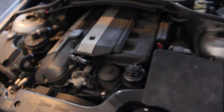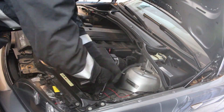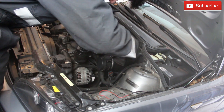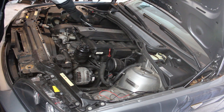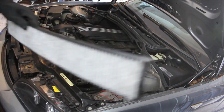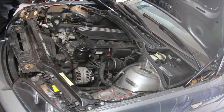This one hose goes down under the intake manifold and the CCV is right in there. It looks like we are going to have to take out the cabin air filter because I'm going to have to take off this engine cover since there's a CCV hose that goes along here. I haven't checked my cabin air filter in quite a while, but it looks like it's in pretty good shape so I'll probably just leave it. I used to have an electric ratchet, but I can't find it now, so I'm going to have to do this whole install with hand tools, which kind of sucks.